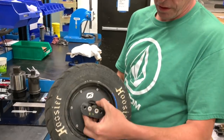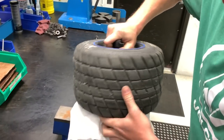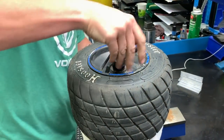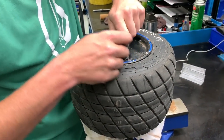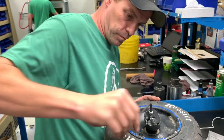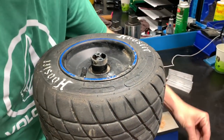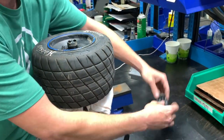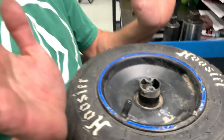I like to hold on to this end here because we're going to pull this out once we undo the cover. Those are good and tight — that's a good sign. Mine are chronically loose. You pretty much only take these off to change the bearings or open the motor up. I take my board apart probably once every four or five weeks during the summer and re-Loctite those things because they're always backing off. That's where the clunk will come from a lot of times — if it's not your bearing, these are a little loose and the assembly is sliding back and forth inside here. That's where you shift hard heel side and it goes clunk. Yeah, that's exactly what I'm having.